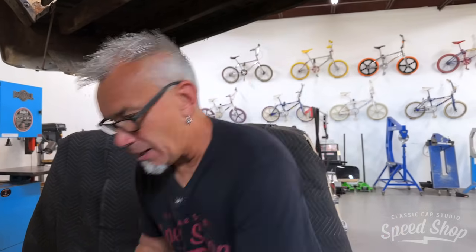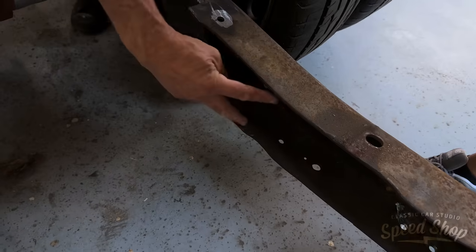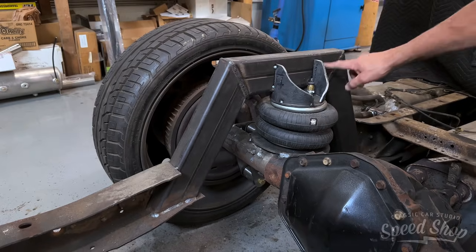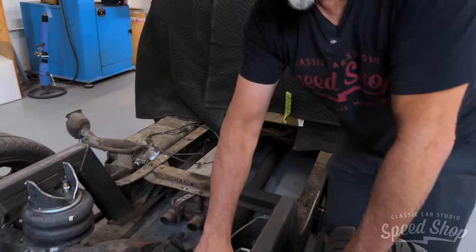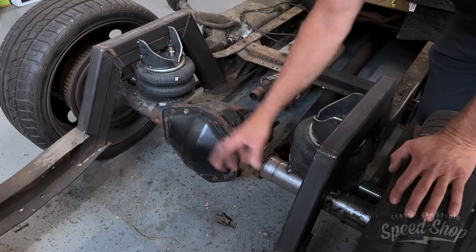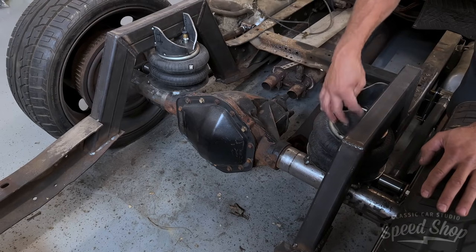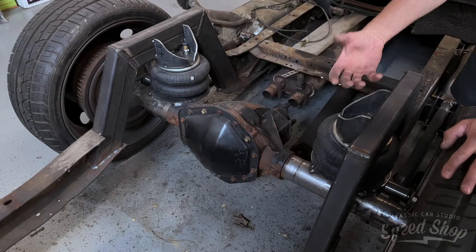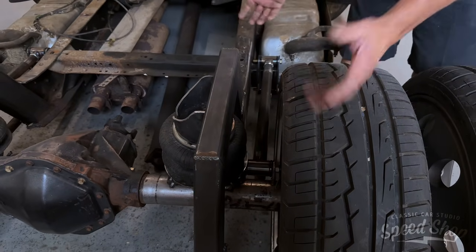I plan on pulling a fifth wheel hitch, and I have one right here. Weight-wise, I'm going to have a bumper hitch as well, so I'm going to do some big plates here that'll tie the frame into the notch to keep that rear strong. Then I've got to do some fish plates on these joints, another plate down here that ties the front of the frame together, and then traditional bridge crossovers that will mount the shocks. First things first — we're going to get rid of these bag brackets and figure out how to fit those big semi sleeve bags. We're also playing around with the four-link bar mounting locations.